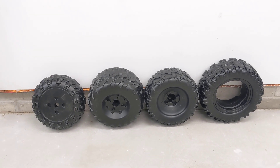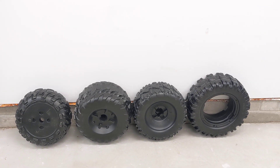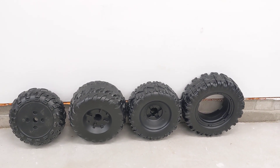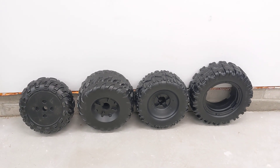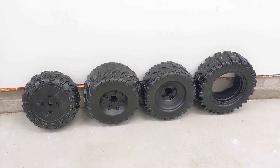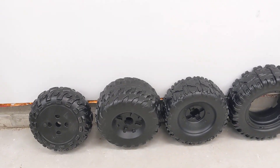You have to allow that tire to spin. If the gearbox had an internal clutch, you'd be happy that the car wasn't spinning the tires, but it actually wouldn't accelerate any faster because this is the clutch. And it's a lot easier and less expensive to replace than if you had an internal clutch on the car. So that tire material is very important — please do not modify that.